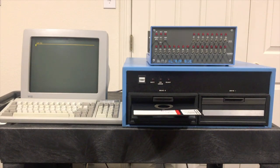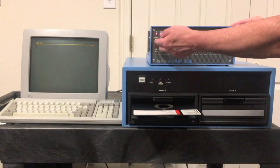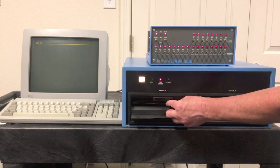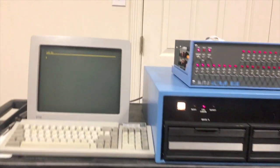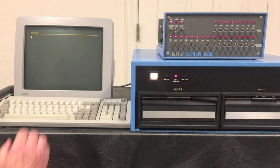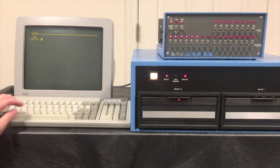So we've assembled our workspace load save routine up at EEPROM address, and I've had the EEPROMs burned and installed them in this machine. So now we're going to see what it's like to turn on this machine and do a cold start. So we power up the Altair, go halt, reset. That's ready now. Let's turn on the disk drive, insert our disk. And now all we have to do, well, here, let's watch it work. Come over here and we jump to FD00, load workspace 6.